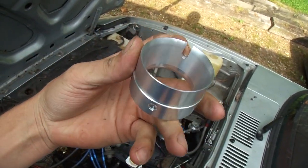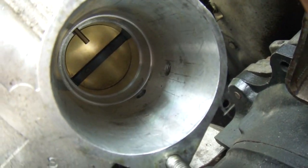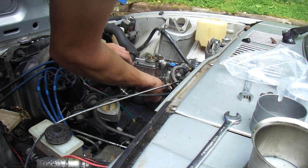This is where there's a jet that sticks down. See the jet that sticks down up in there? It lines up on that groove. Basically, how you know that you've got those lined up right is that the Venturi is easy because it slides over that jet. But for the little director squirter valve thing, you put it in, start the set screw, and wiggle it back and forth. When you feel the set screw locking it down, tighten it a little bit, wiggle it, tighten it, wiggle it, and then you'll be good to go.